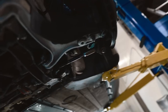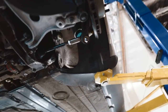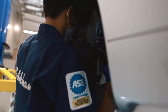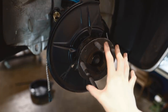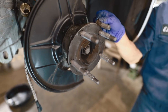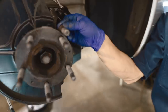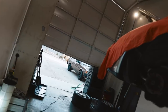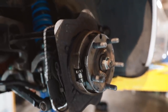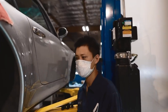Those tie rods were a lot of work — we thought it would take like two hours at most, but it took all afternoon. It's like 4:30 PM. Spent basically the whole day just doing the oil change, drain stuff, and got these tie rods in finally. Now we're working on taking out the calipers so we can take off the rotor, get access to the hub, and change out these studs. We got the extended MSI NASCAR studs installed on both sides — bull nose, chrome moly construction, Teflon and moly coating. The bad news: we're not going to have time to do the rear studs because there's no access room unless you take the entire e-brake shoe assembly off.